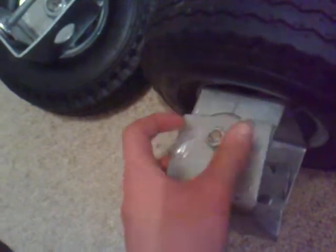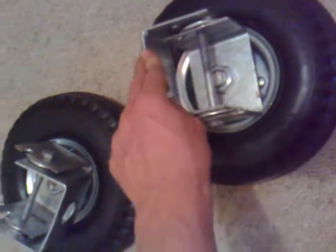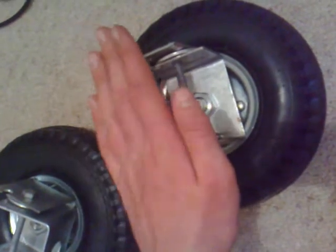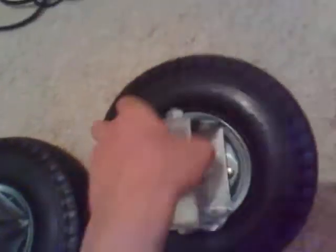It's not fully finished yet, but it's very sturdy. Usually with the ones you buy at the cart shop, they're about this big. When you build your go-kart, you don't mount them straight on to the frame, otherwise you can only move your wheels that much. They have like a little tube which makes the mounting point a lot weaker. This way I can just mount this thing straight on to the frame — there's no other bar here, so it's going to be a bit stronger.